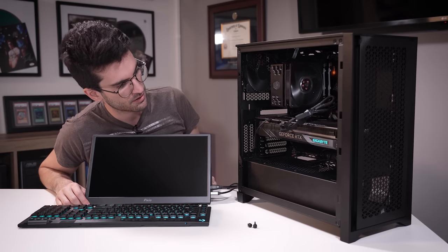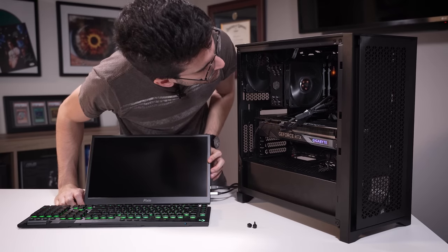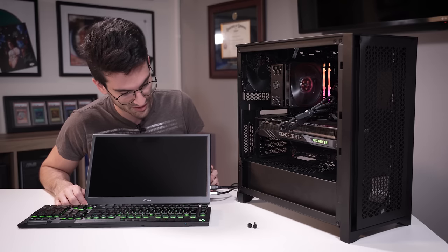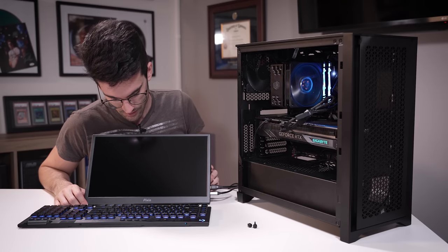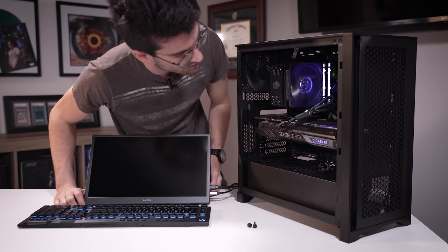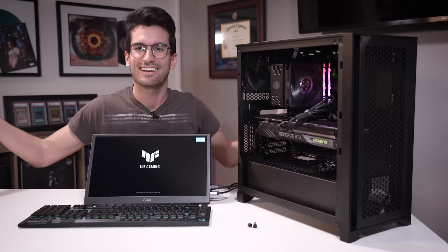We're gonna power it on. The DRAM LED has turned off. That's a really good sign. Come on, give us something. Oh, boot light's on. Look at that. That's all it was. Just an incompatible BIOS.